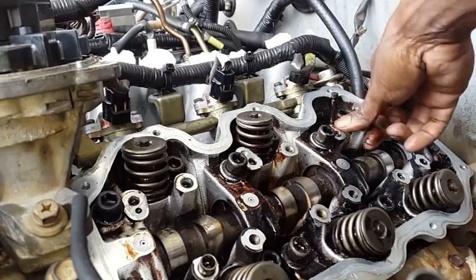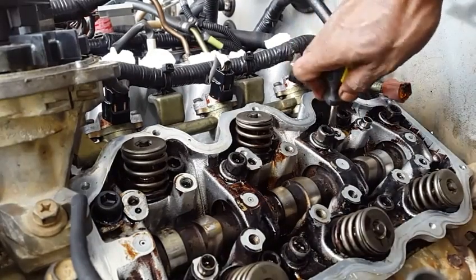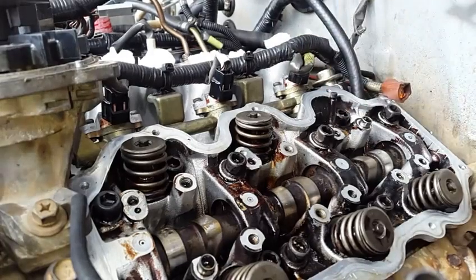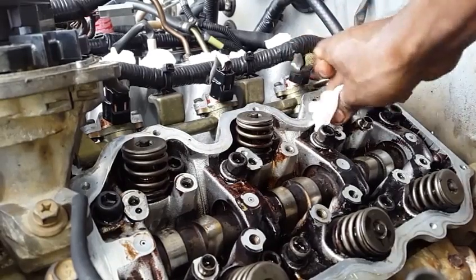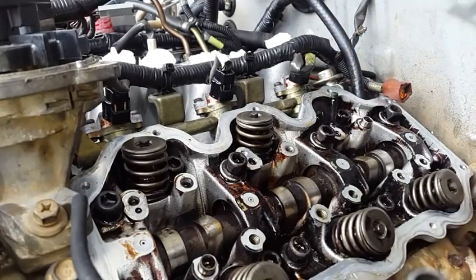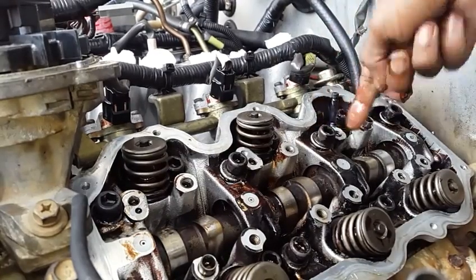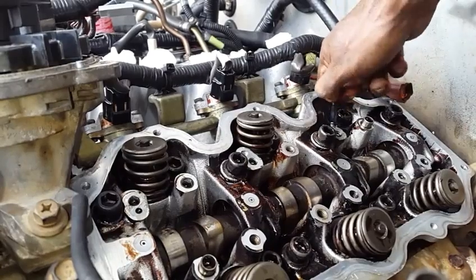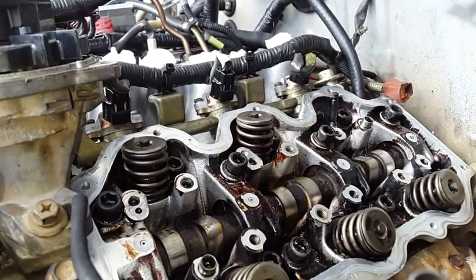You're gonna want to be careful when you're using your prying bar on these edges. You just want to make sure you don't roll them too much — you want to check it and make sure it's completely flat. When you're gonna be doing the valve stem seal and you have the seal removed, you want to make sure you grab the valve and try to see if you can move the stem inside of the guide. You really shouldn't have any kind of movement or play except the clearance that's necessary for moving the valve up and down.